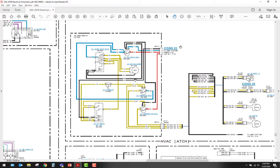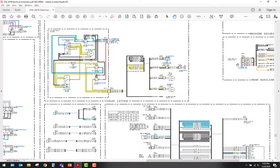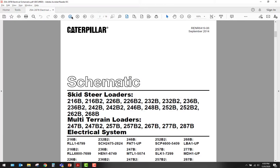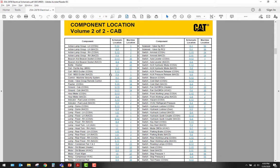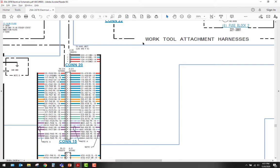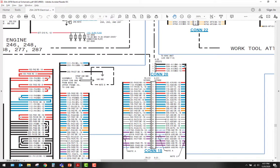There are a few ways we could get to that lower platform harness. I'm going to go back out, go to the top of this schematic, page down — Volume 1 of 2, engine and chassis — connector 20, F10. I'll click that and there it takes me to my harness connector 20, my four-pin connector. The wires going to it just kind of go along and don't go anywhere in the schematic — that's where our heater or air conditioning wiring harness plugs in. Anytime you see wires just end in a schematic, there usually is something on a different schematic that plugs into it.